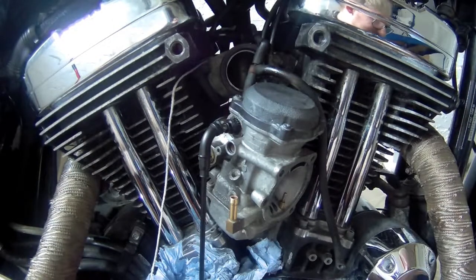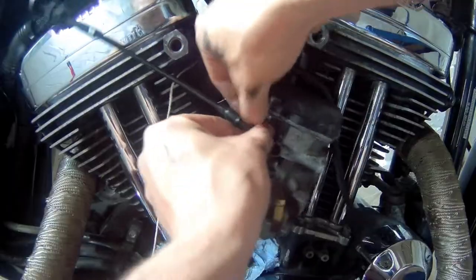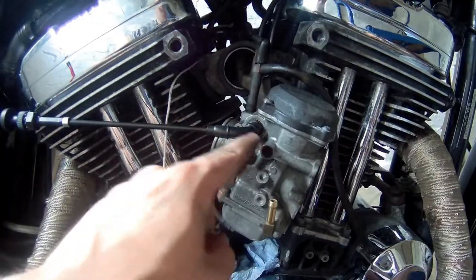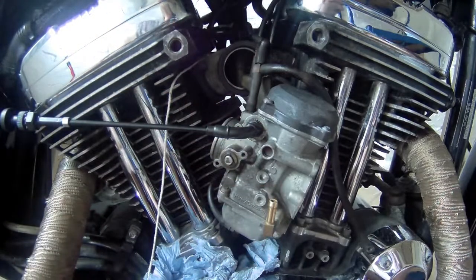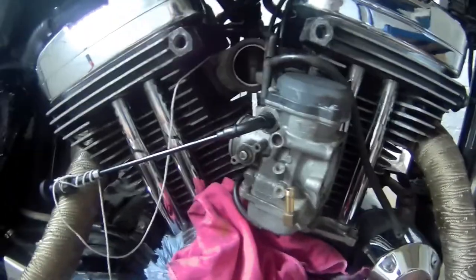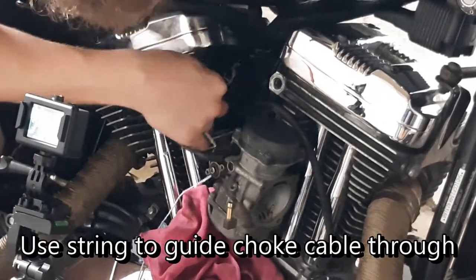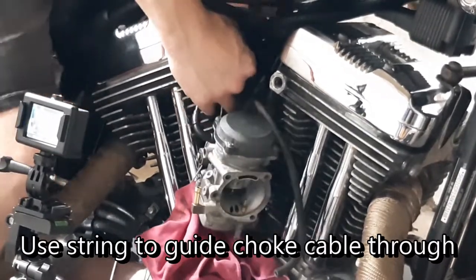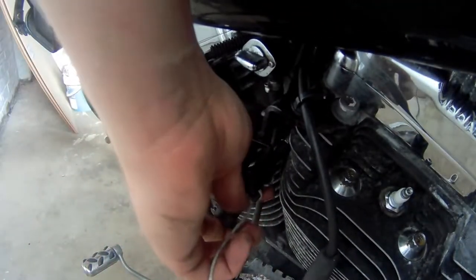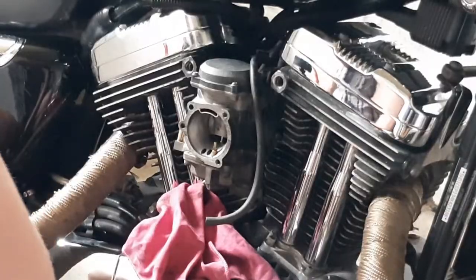I don't want to get crazy on that — it's not made of anything special. I can rub a seal up and it goes over. New choke cable — put the side back together, set the rubber seal over, attach the string to the choke. Get your guide back through. The carb is still disconnected so I might need to reconnect it.